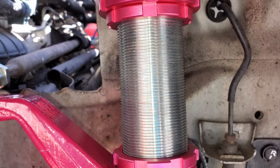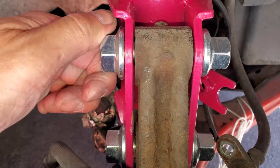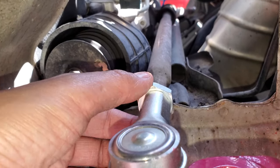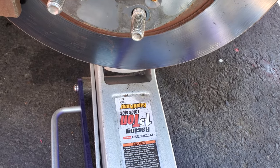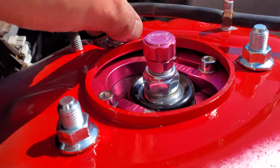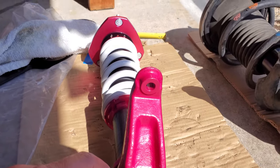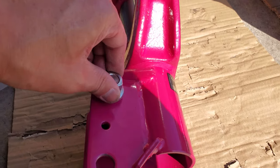Two things to show you. The new coilover is in on the right side. I have two new flange bolts and nuts — they're not torqued down yet, nothing is torqued down, just in place. The tie rod end on the right side I put 13 turns back in, and the locking nut is up against it. I have the floor jack at the bottom holding everything up. I'll torque everything down carefully, little by little. The second thing: this is the left coilover — it's not in yet. When test fitting with the new flange bolt, the top goes in no problem, but the bottom just wouldn't go through — it was off by a hair.